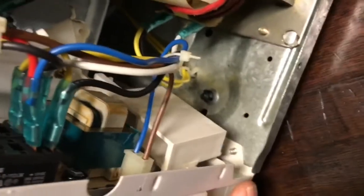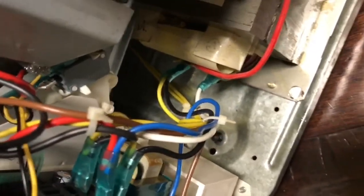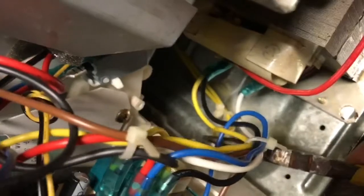I'm pressing the button right now, and the first thing I'm noticing is that there's a piece of cheap-looking plastic that doesn't move. It looks like it has to push up that piece of nylon in order to open the door — it's not able to effectively do that. It looks like the reason is that one of the plastic hinges has broken.